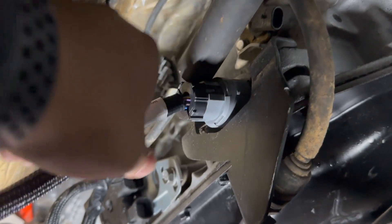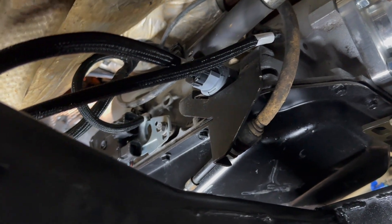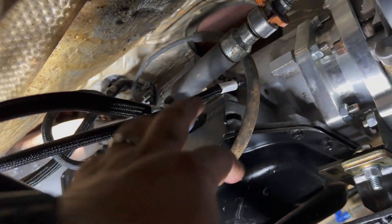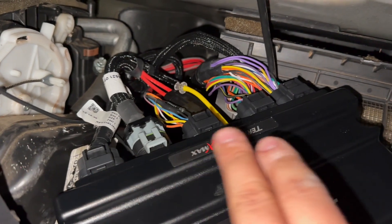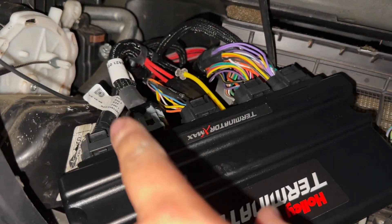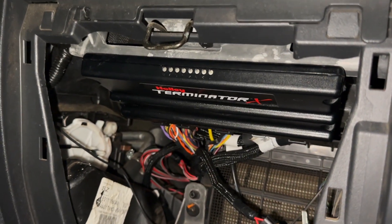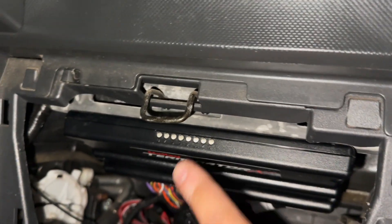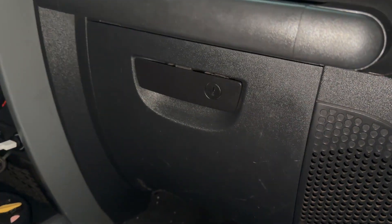Since I am using the 4L80E transmission, I was able to get a transmission control harness, so wiring up the transmission is super sweet and simple. Of course you have your main harness — there's only one way it can go in. And then you have your turbine speed at the front and vehicle speed sensor at the rear. That will take care of the transmission from the wiring side of things. Of course we still have to figure out all of the shifter bracket stuff. When it comes to installing all of the harnesses, you really can't mess this up — each harness will only go into one slot, so safe to assume if it fits, you did it right. And just like that, with a couple of well-placed self-tapping screws into the support beam of the dash, we have our unit installed — nice and secure and simply out of sight.